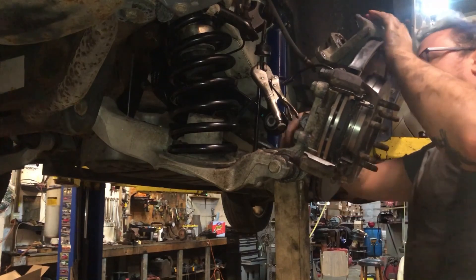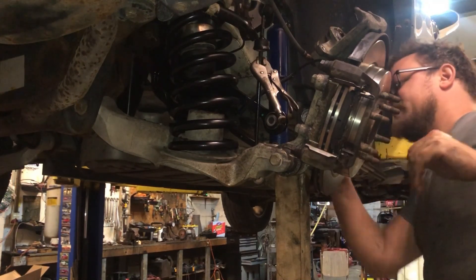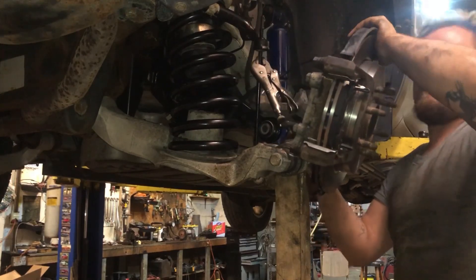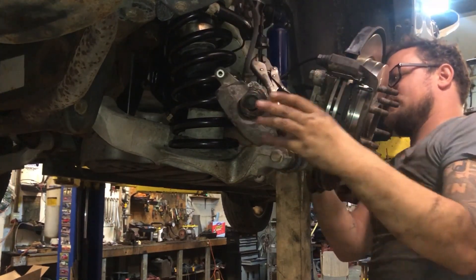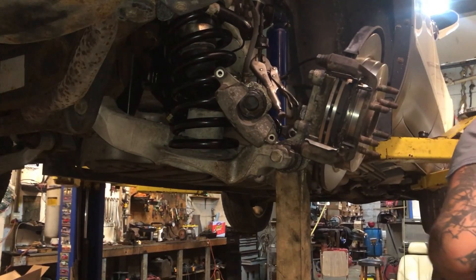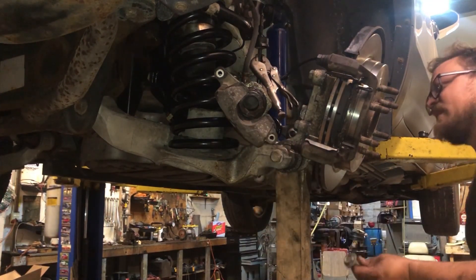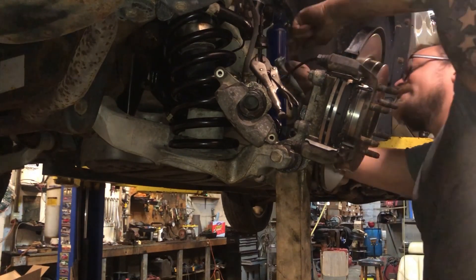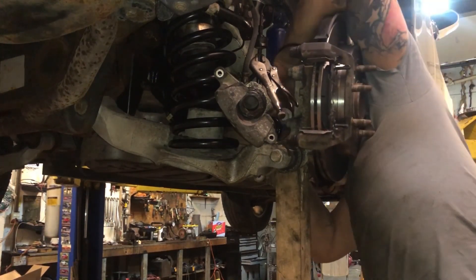The middle control arm goes on the outside front-facing part. It's a lot safer to just use a jack on the ground instead of extending the jack with a chunk of wood — I recommend that, I don't want you guys hurting yourselves. Jack up a little more until I can line up this middle control arm and get a bolt started so that all the pressure is not on the jack. The bolt has a really flat hex nut on the end with no washer on the inside. A lot easier to line this up with an extra pair of hands.